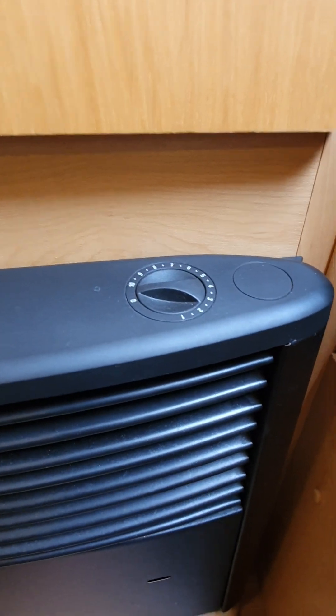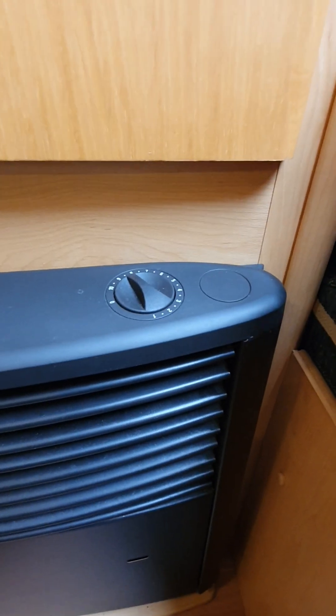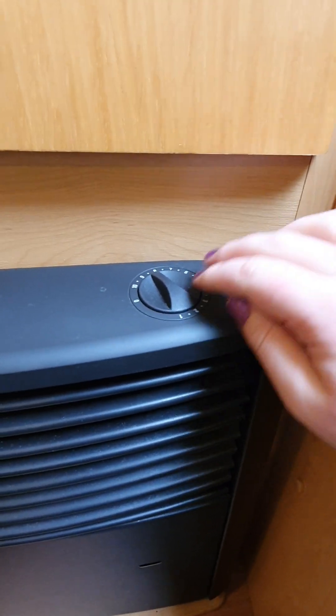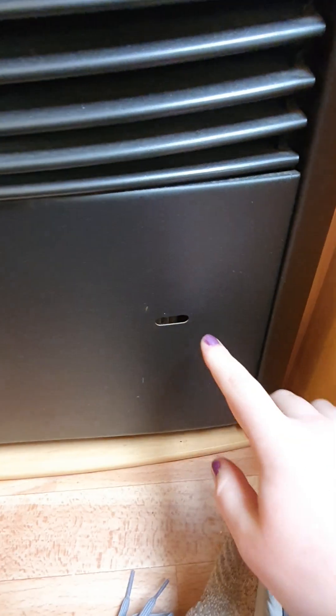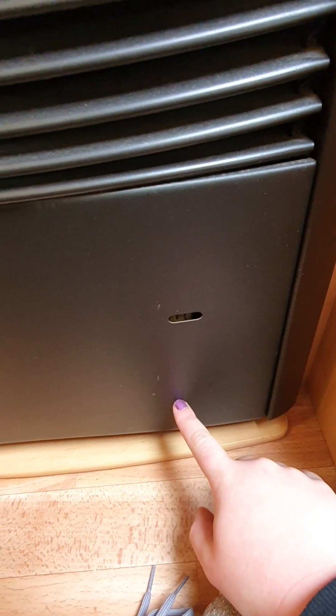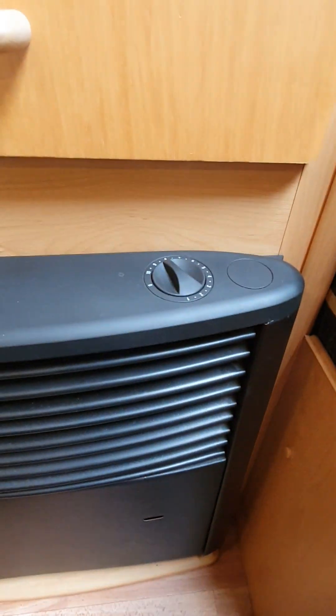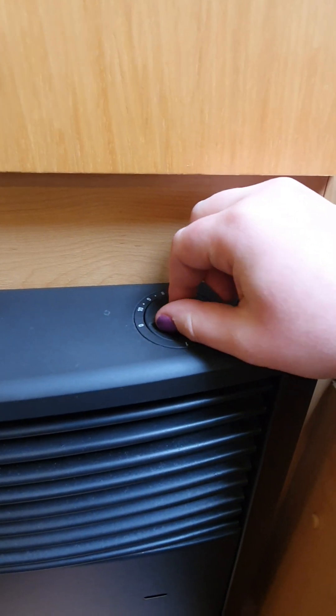On the right-hand side is to run your heater on gas. Turn it up quite high to start with — you'll hear it ticking as the heater tries to ignite. Push this purge button in. There is a little glass viewing window just down here, about 25 mm in, that matches the shape of this. When you've got the purge button pushed down and it's trying to ignite, you'll get a blue flame. Once it's held that blue flame for a few seconds, let go of the purge button and it should kick into a nice bright yellow flame. Once ignited, you can adjust your temperature from one right around to 10, and to turn it off on gas just click it just past zero — you'll feel it click and it'll be off.